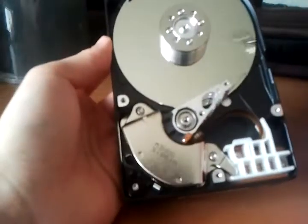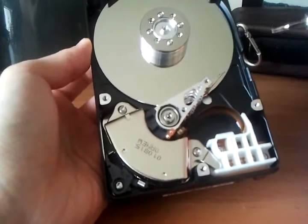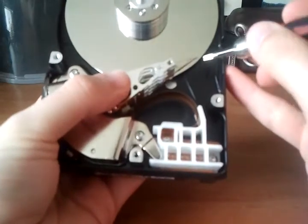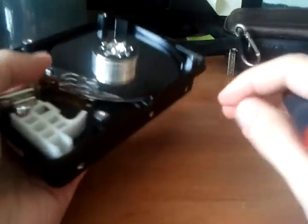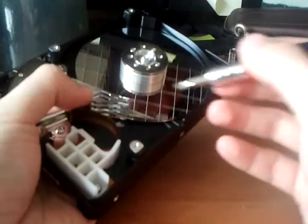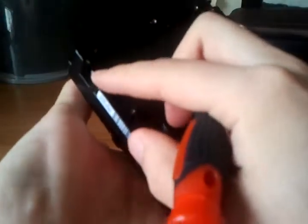You'll notice the disk drive right here. It's interesting that the head isn't retracted — I guess last time I pulled this drive I didn't exactly properly shut it down. You'll notice how a disk drive operates: there's at least one platter coated with a special magnetic material so that you can write specific bits in rings around it. The read-write armature has a head mounted at the tip — a very tiny little piece underneath the spring tension armature. While the disk is spinning, it creates kind of like a hovercraft effect — a layer of air that the head rides on, less than a hair's width floating above the disk. It can either write data to the bits or read and pick up the data. The flex cable goes through to the contacts on the main controller board.